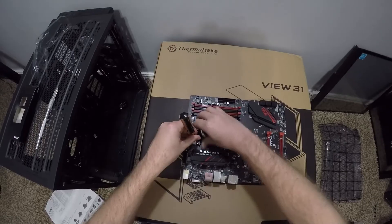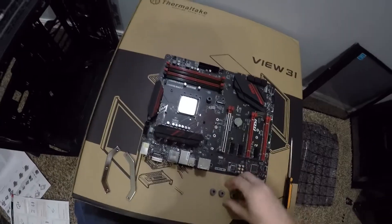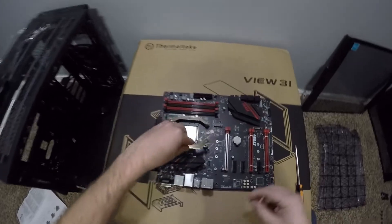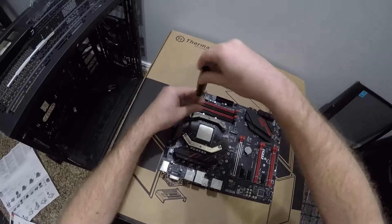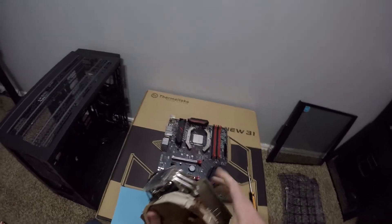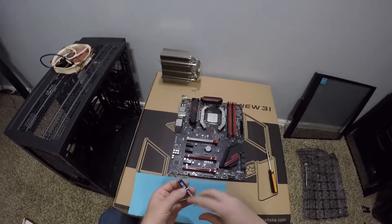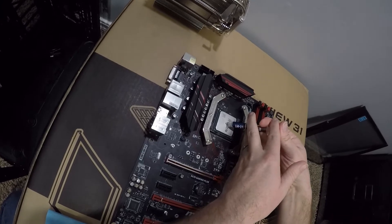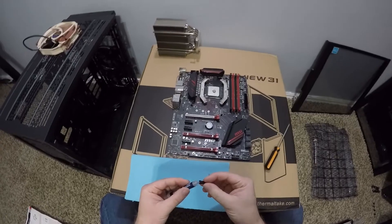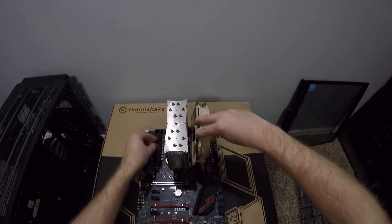Next we need to get it ready to put a heat sink and fan on top. In my case I need to change out the brackets because I'm going with an aftermarket cooling fan. If you want to see more about those components, you can check out a video in the description where I show an unboxing and talk through my rationale for the parts I chose. With that tightened down, I'm now ready to put my cooling tower and fan assembly on. For this one you have to take the fan off to get to the screws that hold it down. Then apply your thermal paste — typically a pea-sized dot to the center of the CPU. When you press the cooling tower down onto that, it spreads it out evenly. Seal it back up, make sure everything is in, tighten it up, and clip the fan back on.